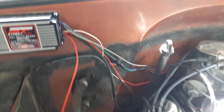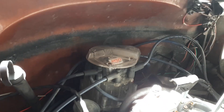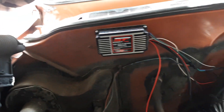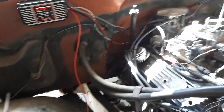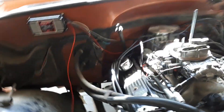I made all of the solder connections to connect all of the lead wires together, soldered the harness to the coil, and soldered the ground ring harness onto the ground. For now I just ran the positive to the battery directly — I need 10 gauge wire to extend it and route it properly along the side, but I don't have any 10 gauge wire right now, so this will be fine for now. I'll extend it properly when I can buy some 10 gauge wire.